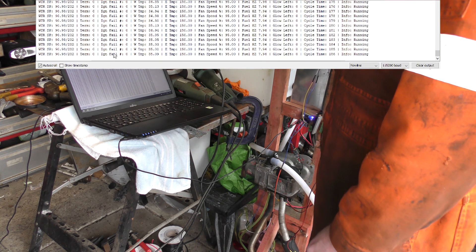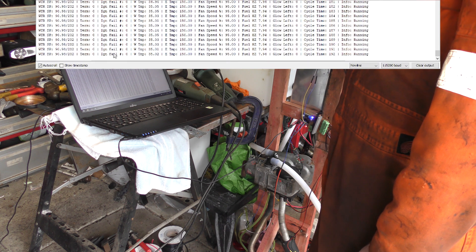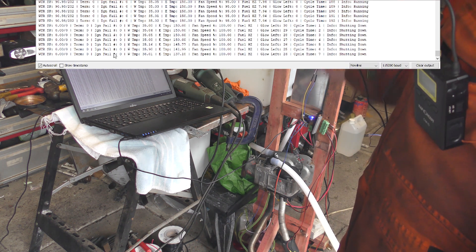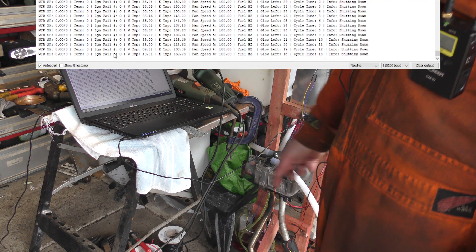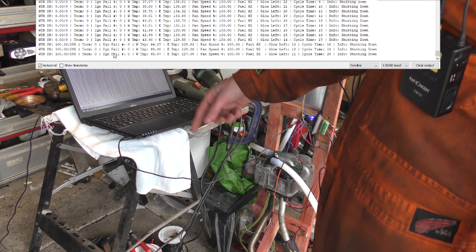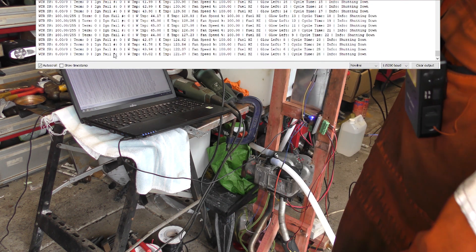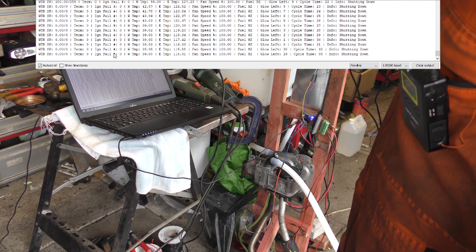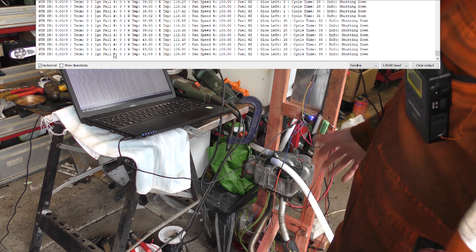Let me turn this off just now and we shall talk about it. You can just hold the button for five seconds and then it shuts down. There we go — shower's off. It stops pumping fuel, keeps running the fan until the exhaust temperature falls away through the floor. So I've got it to 44, 45 degrees — it turns the water pump on a little bit just to stop it boiling inside the heater. Runs the glow plug, burns off any remaining fuel, and then it shuts down once the exhaust temperature gets below 70 — something like that. It runs until it's cool.